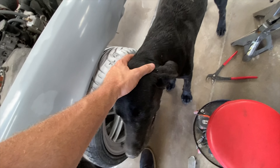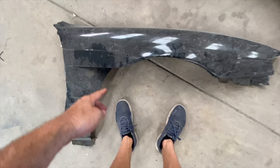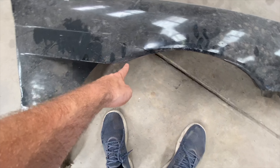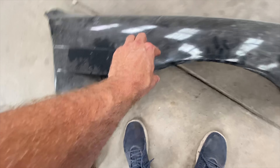He was just cutting my front fenders. So I got — it's easier to show over here. This is my front fender. A normal front fender continues right here and comes down like that. I've cut about two inches out of it all the way around on the last fender to fit 265s. We had to trim this up as well to do that — this piece went right there, and that's how I fit 265s. People ask me that all the time.